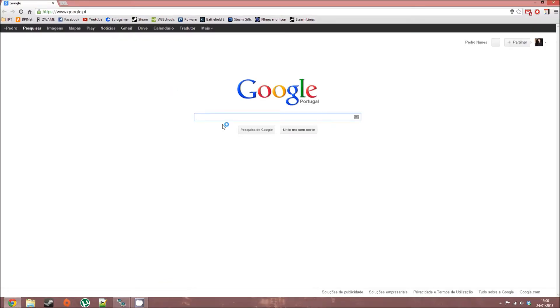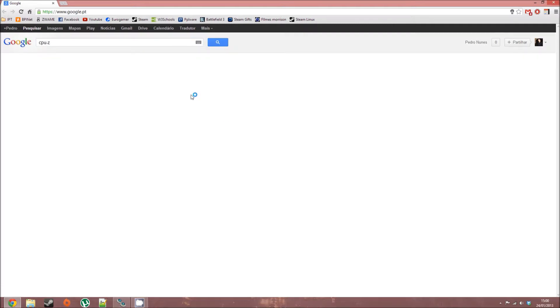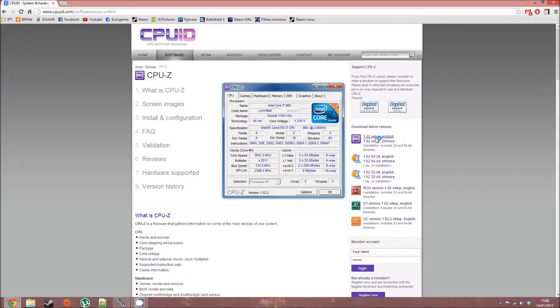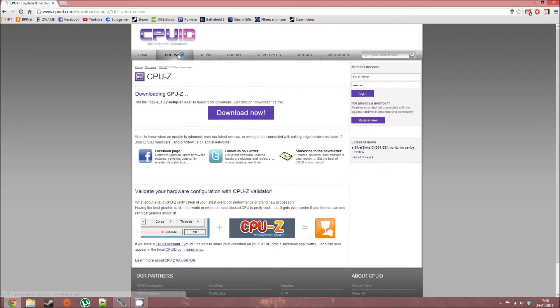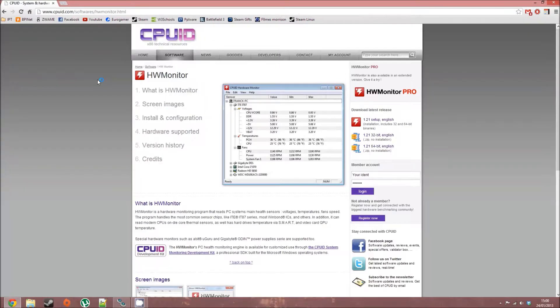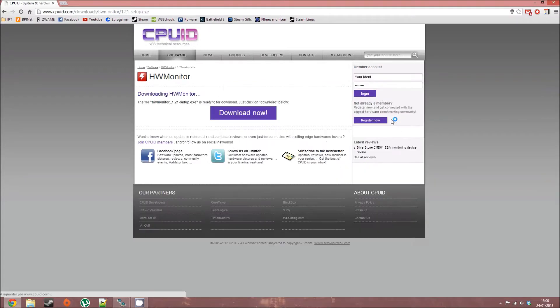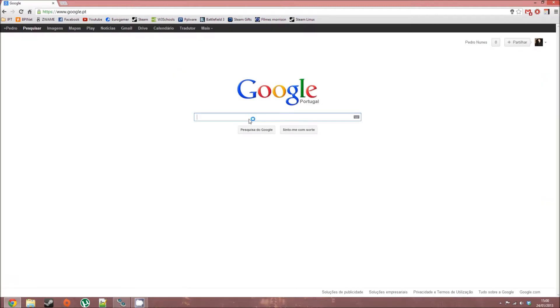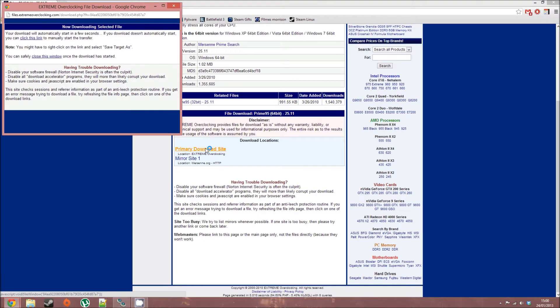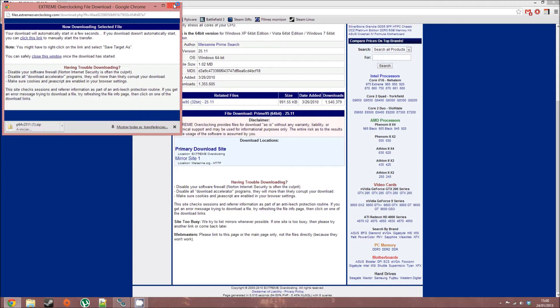Now that the intro has passed, you're gonna need to grab some software. You're gonna need to grab CPU-Z, which is gonna show you the frequency, multiplier, and frontside bus that you are running. It's not working too well in my computer right now — I guess it's a problem of my motherboard. You're gonna need to grab Hardware Monitor, which is gonna show the temperature of your CPU. You cannot pass 62 Celsius degrees — it's dangerous in this CPU. You need to grab Prime95 — be careful with the architecture, 64-bit or 32-bit — it's gonna take your CPU to the limit and see if it's stable or not.